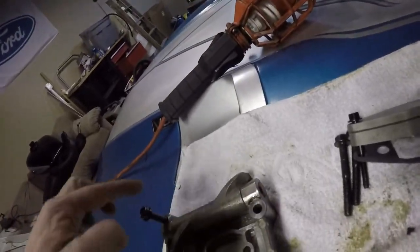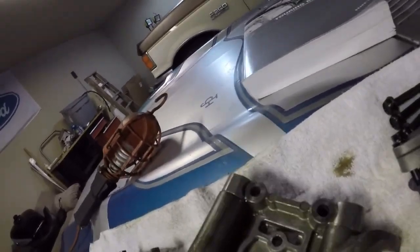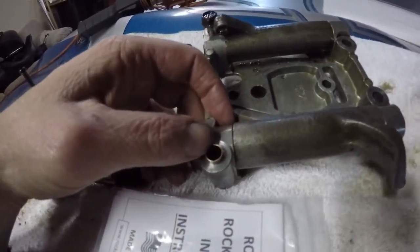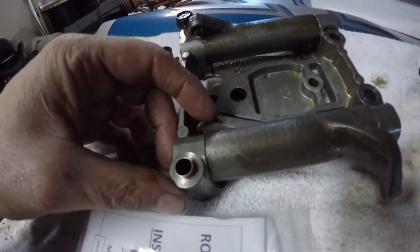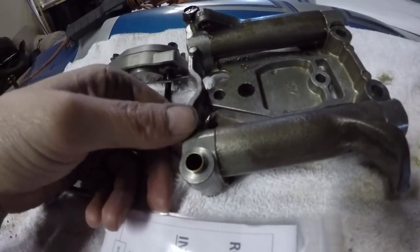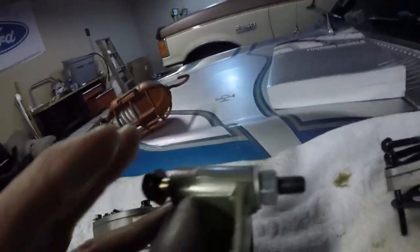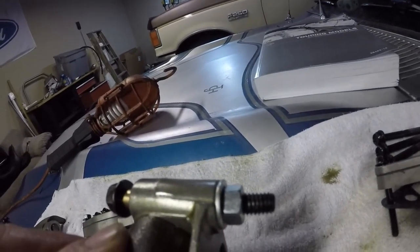So you need to have all the other bolts out. When you're putting these in — the instructions show this and I agree wholeheartedly — make sure your shafts are lined up with your bolt holes. Don't use any tools to try to start the insert in there; use your thumb. If you can't get it to go with your thumb, stop — you're not lined up and you're going to mess up the insert. Once you get it down this far, you can put your original bolt through it with the nut and washer he provided and pull it the rest of the way through. Then you're done.